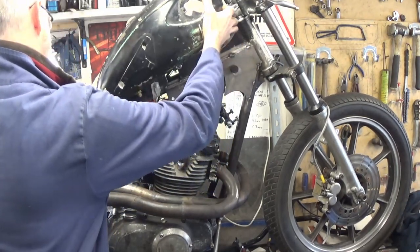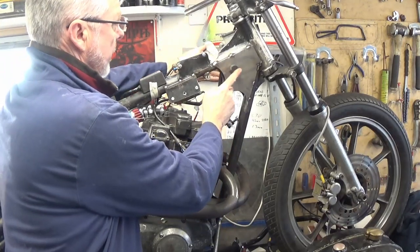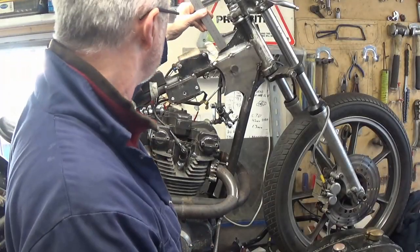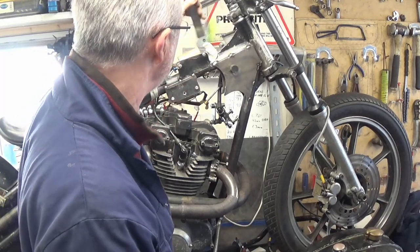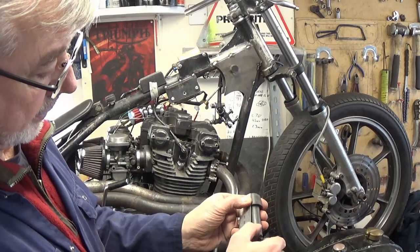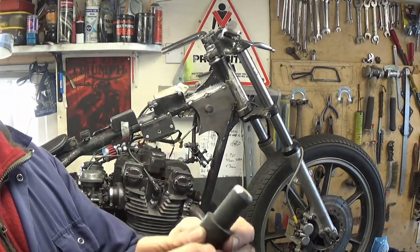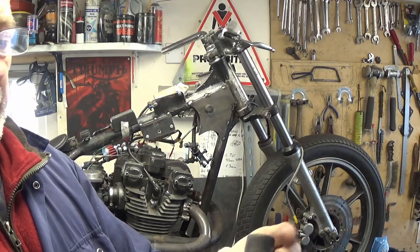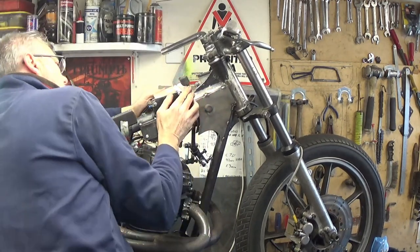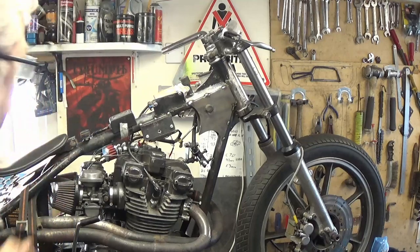So we'll have a look at the centre mounting now — actually we'll look at the front one next. If you notice I have screwed these two rubber bungs. Now we'll need this one to sit there — it's just over 45mm. So the idea is to make that about 55mm high, that's including the rubber. I'll need to cut it off down here and then we'll get that tacked into place. Right, so I've got the front one, cut to length and chamfered all the way around. We'll put it on and I'm just going to hold it in place with a little bit of modelling clay while I get a couple of spots on it. And you can see now it's just a line above the ignition coil.